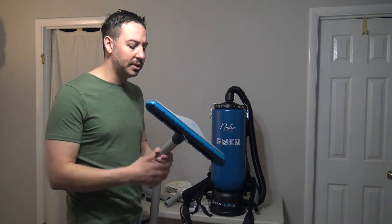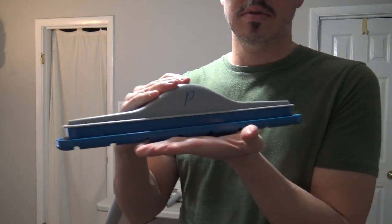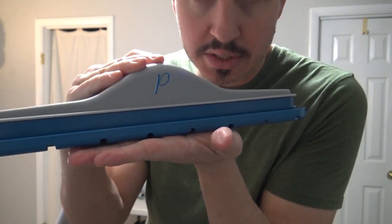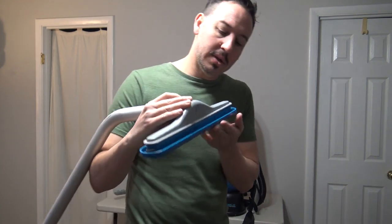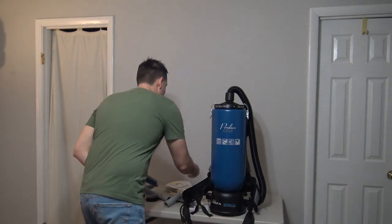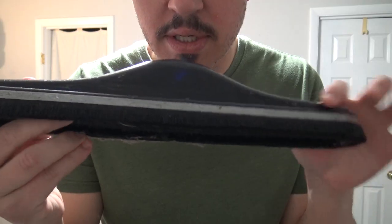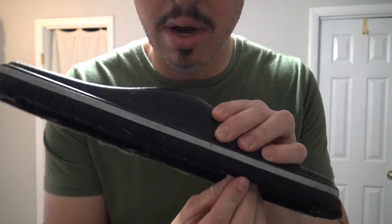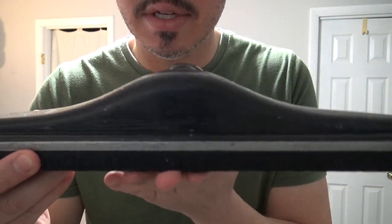Another thing about backpack vacuum cleaners: they typically come with these hard plastic floor attachments that have little slits to allow for airflow — if those slits weren't there and it was sealed, you wouldn't have any airflow and it wouldn't pick up anything. But I'm not a big fan of the hard plastic attachment. I prefer to purchase one of these brush attachments separately for about 20 bucks from a janitorial supply store. It's got brushes but air gets through them no problem, and I find it a little more gentle on floors — less likely to scratch.